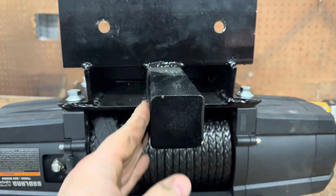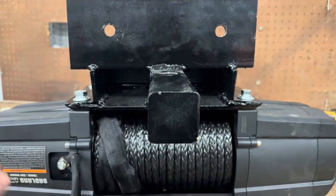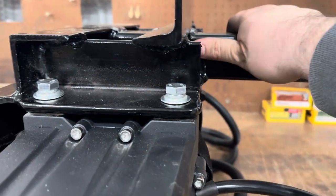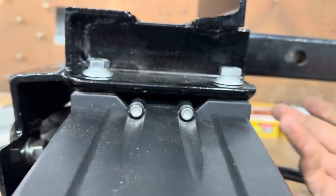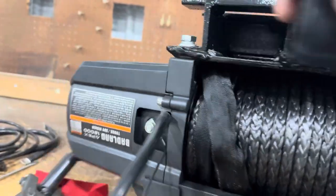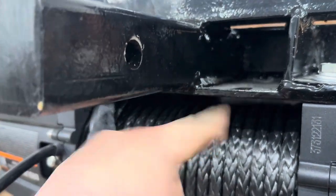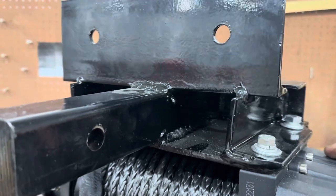We have ourselves a fairly decent and very strong winch mount. These holes, as we've talked about before, correspond to the holes on the spare tire mount for my Orange Line EQ 16 trailer. We have a two-inch hitch receiver that is solid, and I did plug weld on the other side — this is a doubled-up plate right here. I drilled out five-eighths holes in this plate so I could really burn in on this solid tube.